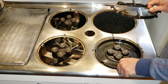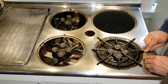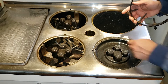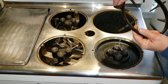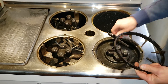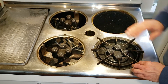Put the drip ring down. Now there are two types of burner grates on a Model C. I have one with tabs that fit into cutouts on the chrome top — you just put the tab into the cutout and it fits perfectly. You don't need to worry about the placement of the drip ring because the tabs go into the top. If you've got the kind of burner grate that has little pins that stick out, they will only fit in holes inside the ring. You'll end up turning this around until the holes align perfectly and then drop in your burner grate. It's a little bit of a pain, but that's the way some of them are — what you've got to do depends on what you've got. Do it for the others as well.